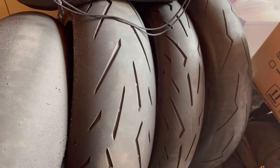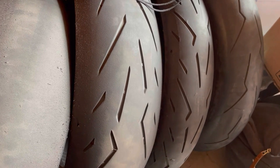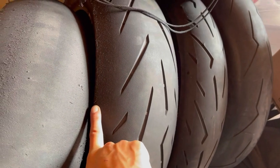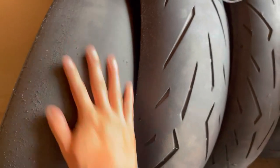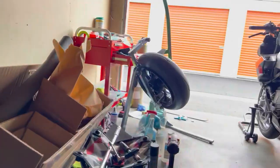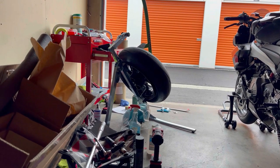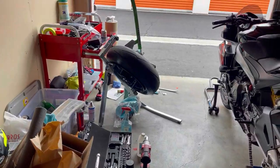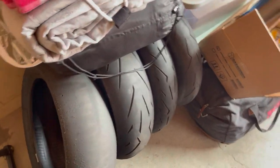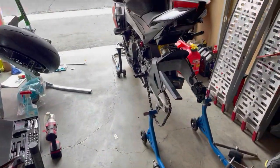The tire was fine — I rode Saturday and Sunday at an intermediate pace for that shakedown weekend and used the edge all the way. It's a 180/55 profile whereas typical slicks and more performance-oriented tires like the Super Corsa SP are 180/60. I prefer the taller 180/60 profile from my past bikes, so I'm switching back to that and will probably sell the Rosso Corsa 2.